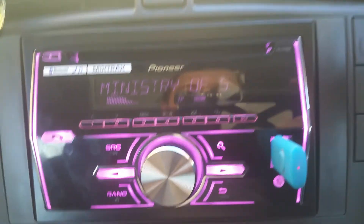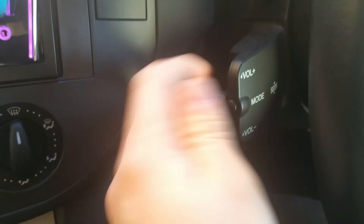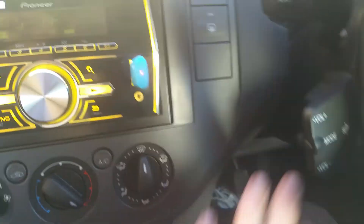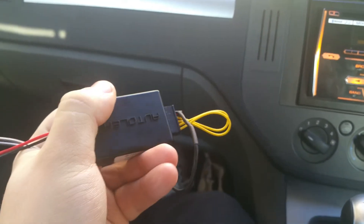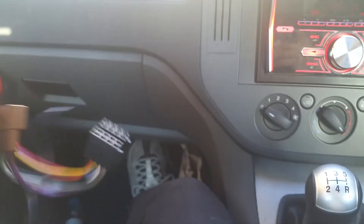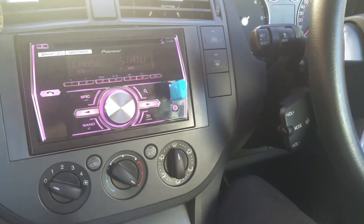It's got RCAs on the back, which is handy — you can add your amp for your sub on it. It's got two little ports. If you're going to get one of these, you need the lead for that. I didn't have the money at the time I installed it so I bought the wiring kit — you need something like a resistive module. I got that from Halfords as well. The one I had was made for my old radio in my old car — it probably would fit this radio but it won't fit this car because that was from a Mark 1 ST. You can get the lead from Halfords but it's quite expensive there, so your best bet is probably eBay depending on budget.